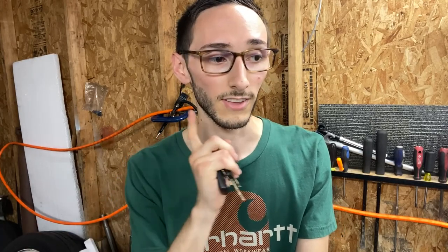It's not that bad. Also, if you do replace your valve stem seals or even your valve springs for that matter, I didn't replace my valve springs because there's really no reason to. Ford built the motor pretty good for the time. So for those that don't know, the stock 4.6 two-valve valve springs are good for up to 6,500 RPM shifts.